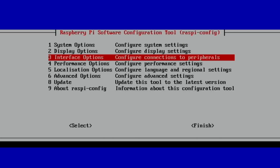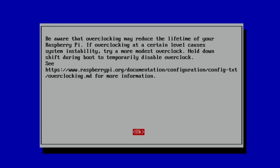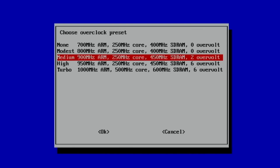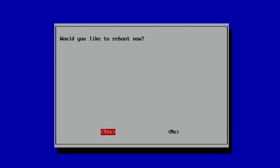If I go into sudo raspi-config there's something cool you can do on older pies - if we go to Performance and Overclock and ignore the warning, we can overclock. Let's go in the middle - 900MHz, which needs a 2 overvolt. It's currently using 1.8 watts of power so I'm not worried about that. Hit OK and Finish and that will want to reboot.